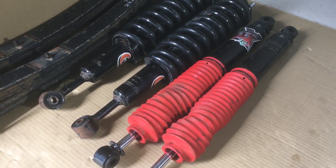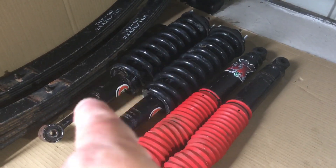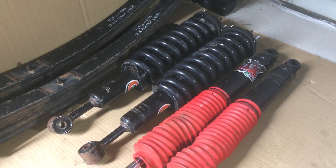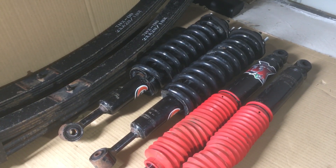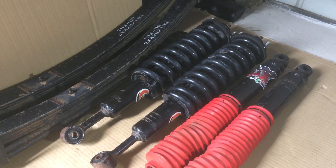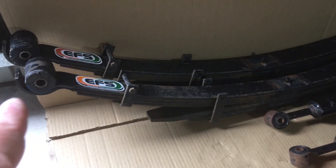This gear - I'd say it's worth about $2,000 to $2,500. A Dobinsons Hilux kit is worth about $2,500, talking monotubes, and you've got options. They don't come with these bushes. So you've got your leaf springs if you're a Hilux, your coil springs, your front struts, your rear shock absorbers, your bushes for each end, your greasable shackles, your greasable pins, and your U-bolts.